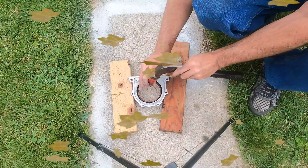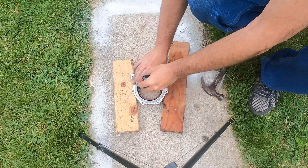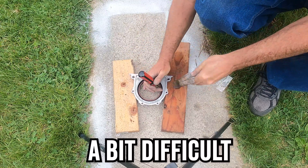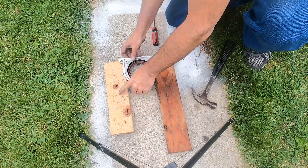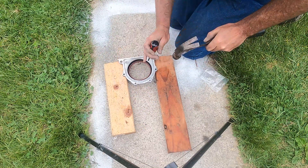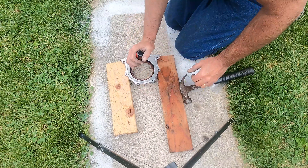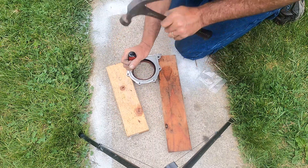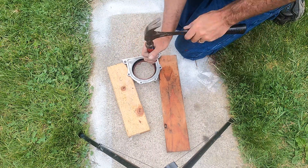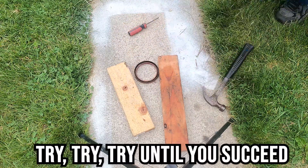The first thing I need to do is remove the old seals from the parts, and this is the part that's going to be a little bit nerve-wracking. I used a screwdriver to basically pound these out. I'm not worried about damaging the old seals but I don't want to damage the parts or any of the sealing surfaces. Of course since this is a BMW they're not going to seal properly anyway, but I use a screwdriver to bang this and eventually it does come loose.